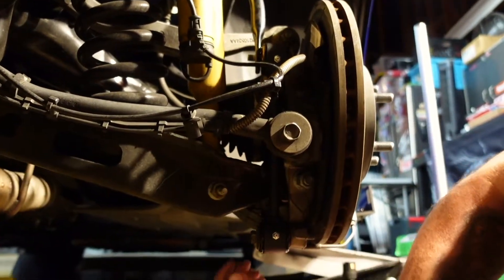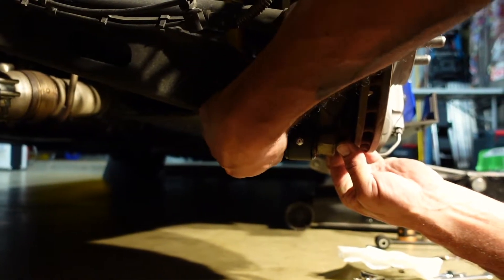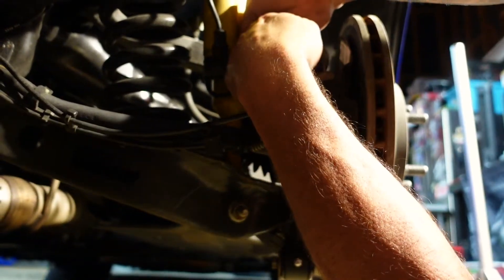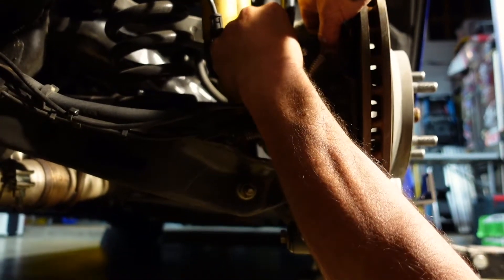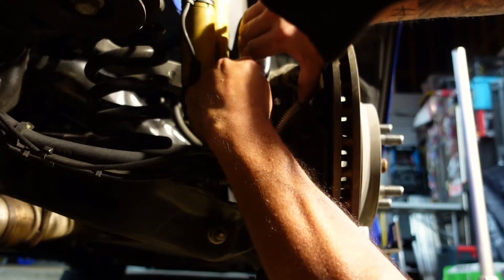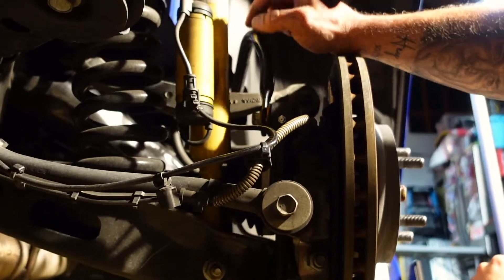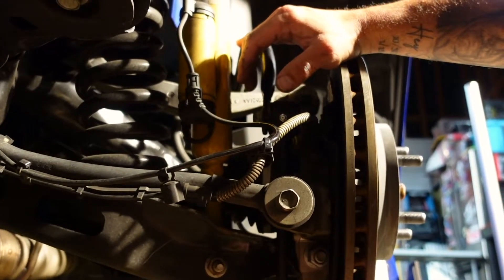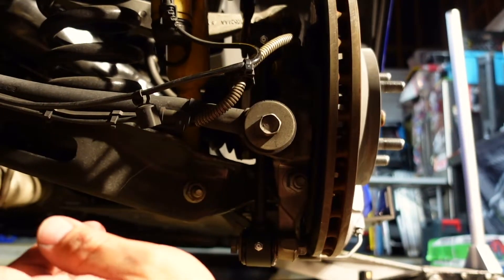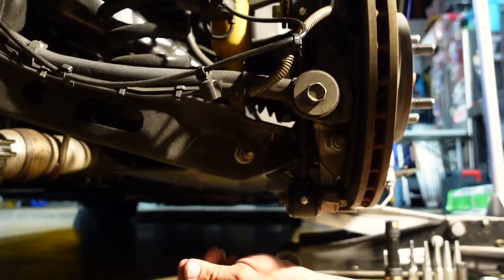We're locked in top and bottom. Go ahead and install your nut. I am not using Loctite on this — the factory ones were not Loctited, so I'm not Loctiting them. They have a torque specification of 45 foot-pounds and we will torque them back to that. You're probably going to ask how we're going to get a torque wrench in there — I can get it on the bottom, might not be able to get on the top. Now that the new end link is on, that's exactly what it looks like. We will torque the top bolt and bottom bolt, then go to the other side, do the same thing, snug the bolts, make sure there's clearance, torque them down, then put the wheels and tires back on and torque the lug nuts.